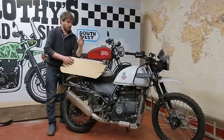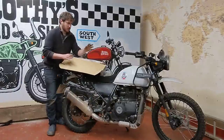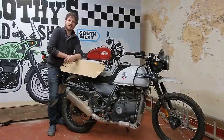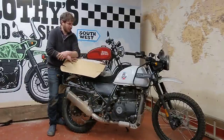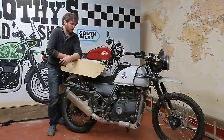I just needed another bike quickly, so I thought, well, I liked the first Himalayan, so I bought the second one. This bike was used for that and then I used it last year on the A2 fleet for people to ride. And then it's been sacked up - it's just had a few issues. Head bearings have got notchy, it's got a bent handlebar from when it fell off its stand, broken gear lever, brake lever. It's just a bit neglected, so I thought, whilst I'm reconditioning it and bringing it back up to scratch, I'd do a few changes.